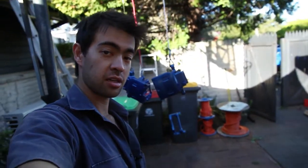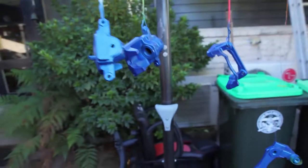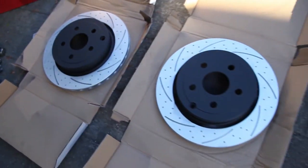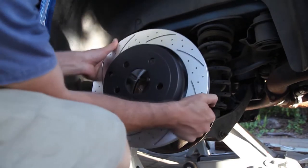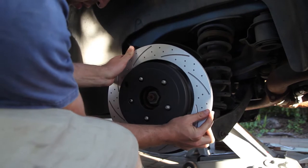Okay, so I've sprayed everything. It's dried for a while and I think I'm happy with it — they look alright. Let's go take a look at the rotors. Yeah, they look nice and even. Now it's time to go put everything back on. The first thing to go back on is your rotor. This might be a little bit tricky because your handbrake shoes will be pushing against it as you go to slide it on, so you'll have to wiggle it backwards and forwards, give it a knock here and there, but eventually she'll go on.